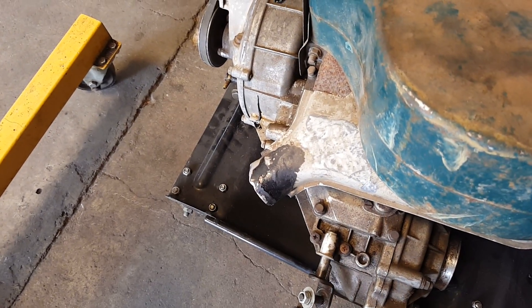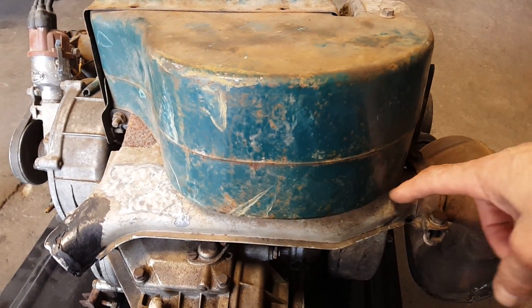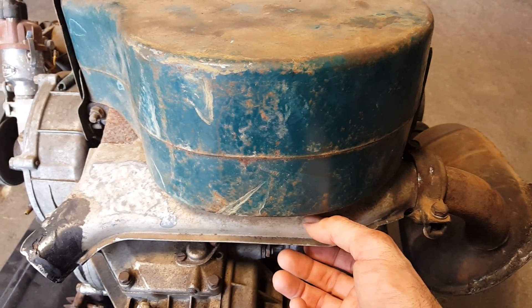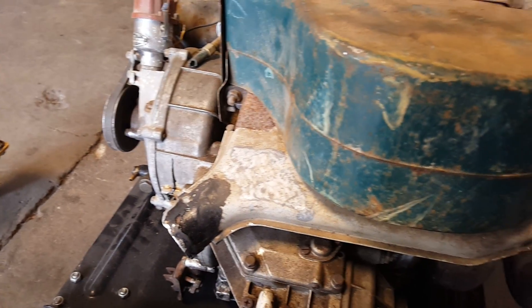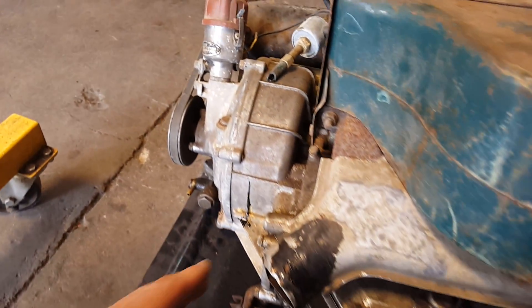The exterior of the exhaust manifold is used for heat. There's a little bit of air blown from the fan into the skirt or housing of this heat exchanger, and it blows a little air into a tube that you can control for the car. That's your heat system — pretty ingenious.